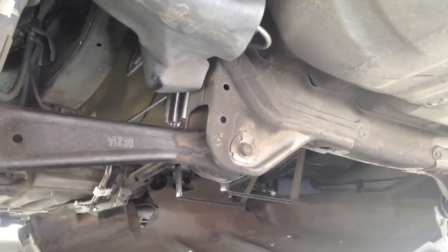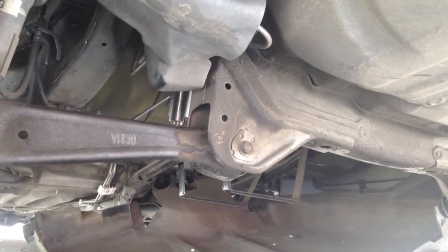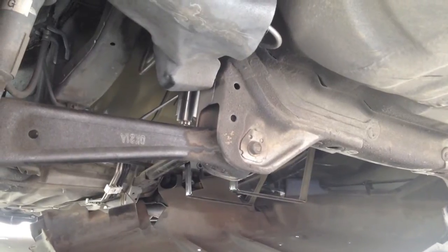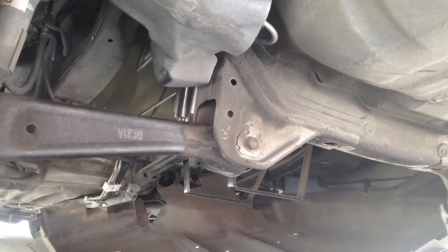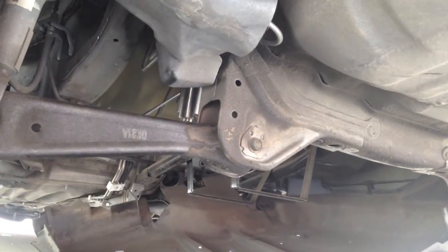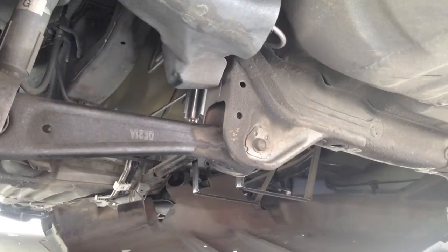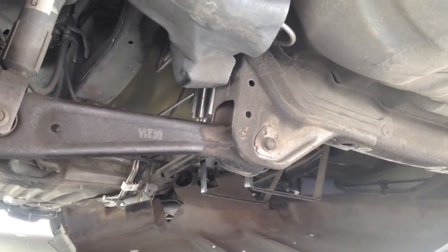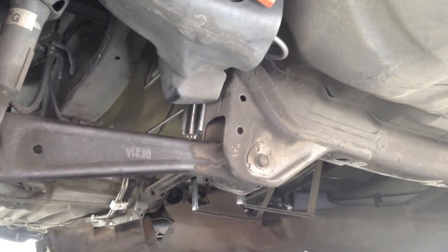Try it at your own risk. It's really easy to do. The filter cost me $32. I'm going to start doing this every 10,000 miles — they say 15,000, but on my model, the '98 to 2000s, they have the third injector problems, and injectors cost a lot of money to change. So I figure $30 every eight months or so, takes 30 minutes — no big deal.